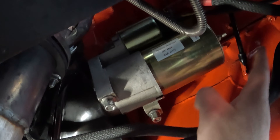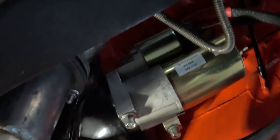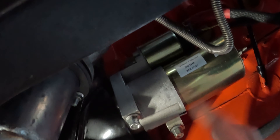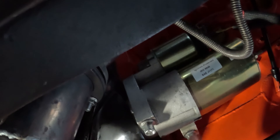While I'm down here, let me give you a warning. This is one of the original or OEM reproduction starters — it's about that much longer. They're really, really heavy. And the second you take those cables off and those two bolts out, the only thing between it and the ground is your noggin. It will hurt really bad. Be careful when taking these out.